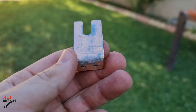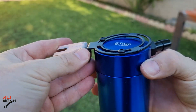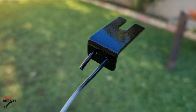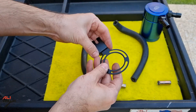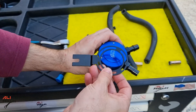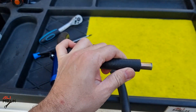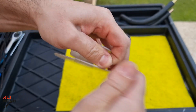Making a bracket like this won't be easy if you don't have tools. I came up with this idea to make a simple bracket and mount it on the oil catch can bracket so it gives me extra distance. I had to paint it matte black to match the other bracket. I'm attaching these two together using two M3 by 10-millimeter bolts.